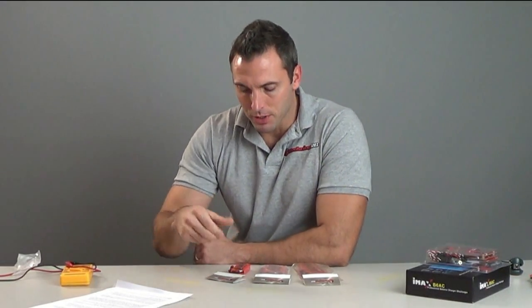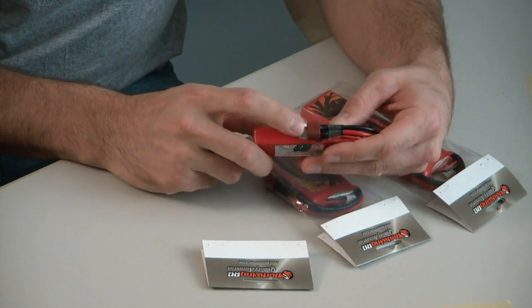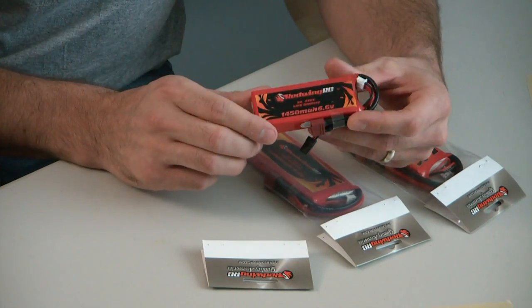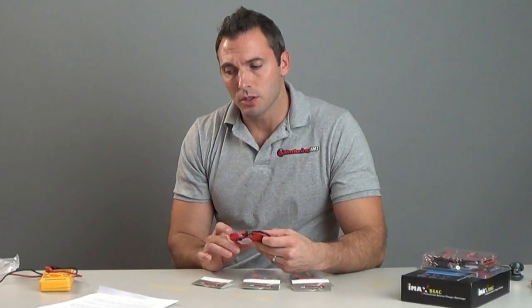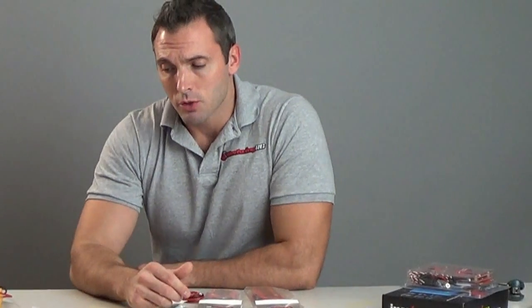So let's briefly talk about one or two batteries. Our batteries come with two plugs on them — one Dean style plug and one JR style plug — so you can easily run one battery to power your receiver and ignition. The fact of the matter is that if you're using a 2.4 GHz radio, you do not need to use two batteries. Traditionally in the RC world, people used two batteries on a gas plane, and that's not for redundancy but to isolate noise.